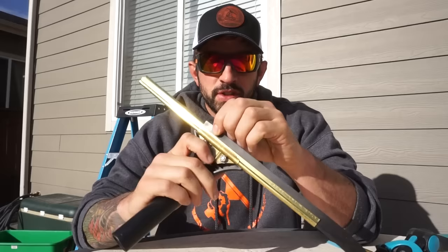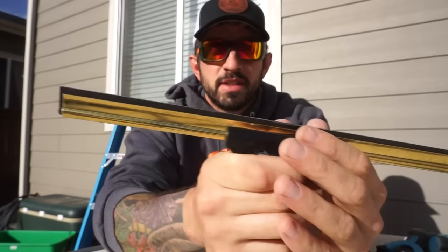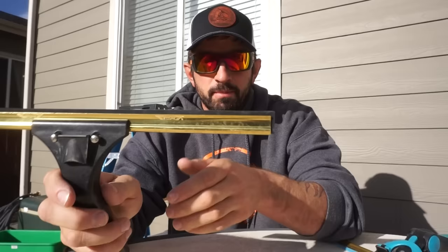When I put the rubber in the channel, I first look at how much is left on each side. When I put the clips in, I leave a little bit of rubber coming out the side to protect the frames of the window — that's very important. If you have nothing sticking out, you can actually scratch frames and leave more detailing work. I suggest always having that little bit of rubber outside the clip.